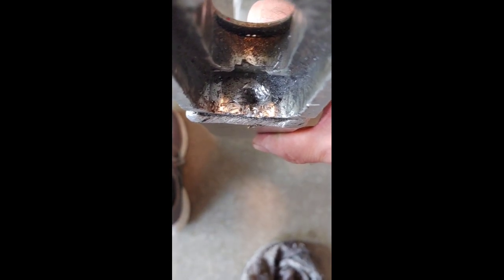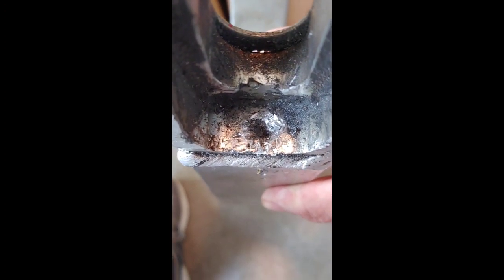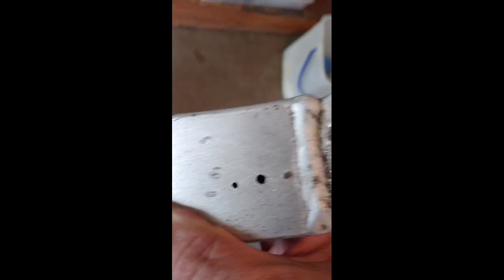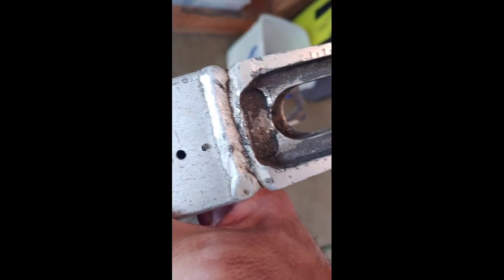Now, this is the side that's given me trouble for the last few months. I really haven't touched the swing arm in the last 3 or 4 months because of that. But tonight, we're going to try to chisel that out. The bolt is still in there. It's hard to see, but there's the top, and that's about an inch, maybe an inch and a quarter long. That's my estimation. But in there you can't see that easy-out tool broken off. There's a hole drilled, but it's broken off, and it's just seized up. So we're going to see what we can do with the air chisel.